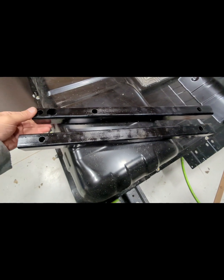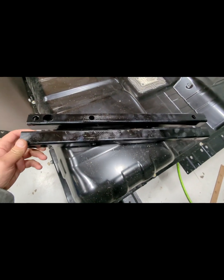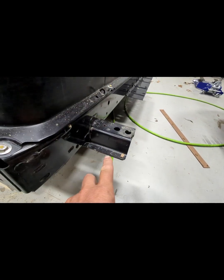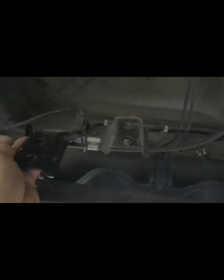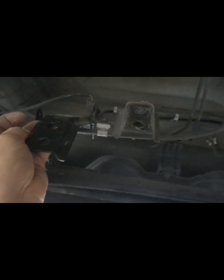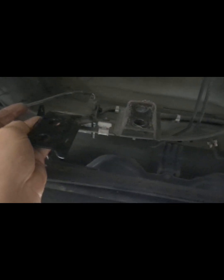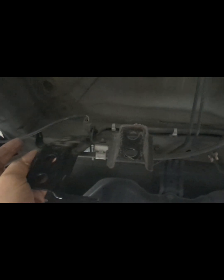You can sort of see how the color codes work out: green to purple, blue to green, and up top blue to blue — that's easy — then green to yellow. That's according to the wiring in the hardware section that Dala has put on his website. Today is install day and I made these bars according to the plans on Dala's website — there's a SketchUp dimensional drawing you can follow. One goes on each side of the rails, making up for the difference in heights between the 24 kilowatt hour pack and the 62 kilowatt hour pack. The 62 kilowatt pack hangs down about an inch and a half, which is the distance being made up for by that rail.